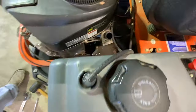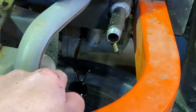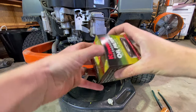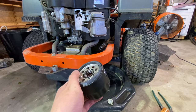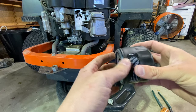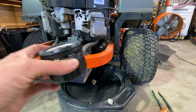There we go - I'm gonna pull it up through here. You can see how the oil runs down the back side and drips down. Once that drips out, grab your new oil filter. Opening it on screen here - you'll notice it has a gasket on top. Make sure on the old one the gasket came off with it. If that gasket didn't come off and it's still on the engine, you'll double-gasket it and you're going to leak oil and have trouble with your engine. We're safe here though.